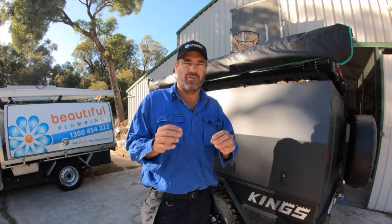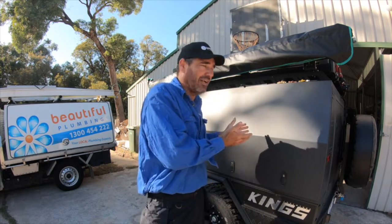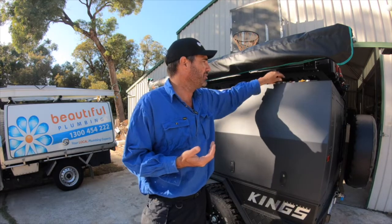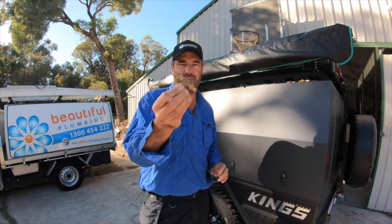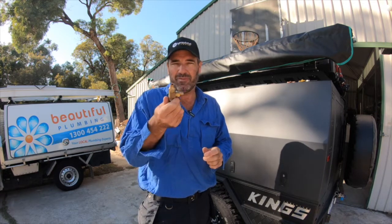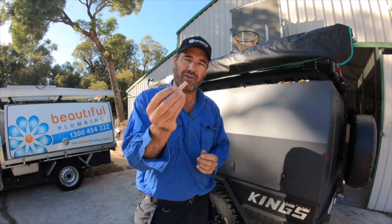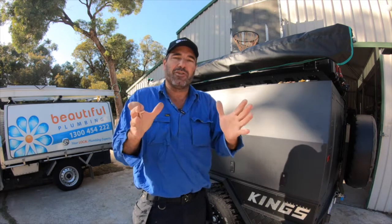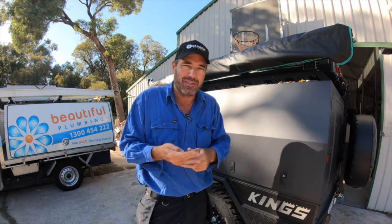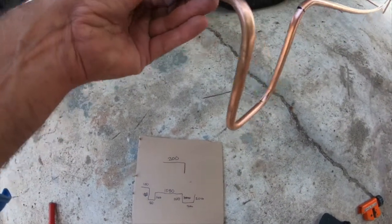On this one, I always weld on my T's, because I think if you're going over rough stuff, once you weld the T, that's there forever. The only other option on a camper trailer - you can't use B-Press fittings, that's what it says in the standards - the only other option is flared fittings. I've got another video about flared fittings and why I don't rate them that much; for road vans you'd be alright. The welded stuff is a bit smaller in size and it's forever. All you need to do is measure up the whole length - some of these angles you've got to go around chassis bars and down and stuff. If you know how to use a bender, which a plumber should know, you draw up all the measurements, grab a bit of cardboard, draw out the shape, and bend up the whole pipe.